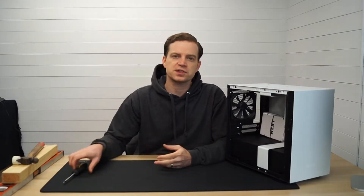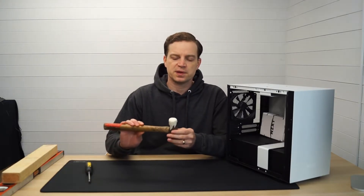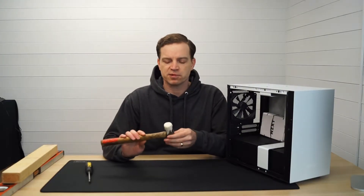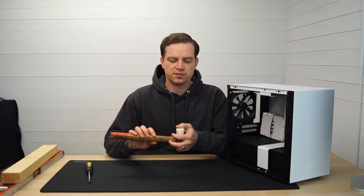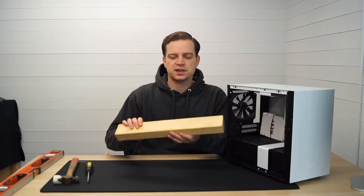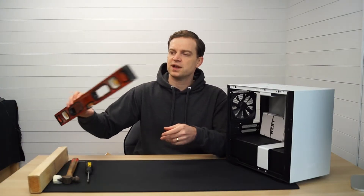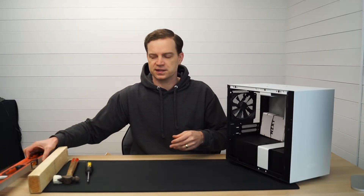The first thing we need to do is strip the case down, but we will need some tools to do it. Obviously we need a screwdriver to be able to take the fans in and out. You'll also need a bit of a hammer, and you should generally use something like a rubber or plastic hammer, but I don't have one around so I've actually taken a normal lump hammer and put loads of different coats of masking tape over the top so it's a little bit softer and it won't damage the metal. Something that you can actually add pressure against, which I'm just using a piece of wood, and something that has a perfectly straight line so that we can make sure that we've got the lines back in the case.